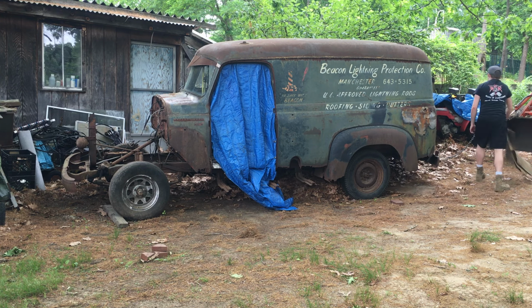That was the main reason for pulling off the front end. The cowl rot up under here. I have to repair and rebuild the A-pillar right here, which I started in that rocker that you saw a couple weeks ago. But I have to get all up inside there with new steel and recreate that whole structure. And then do something in here so that the hinges can have a solid place to mount to on the bottom. And then, of course, I gotta re-drill all these holes that the bolts broke off in and all that fun stuff.